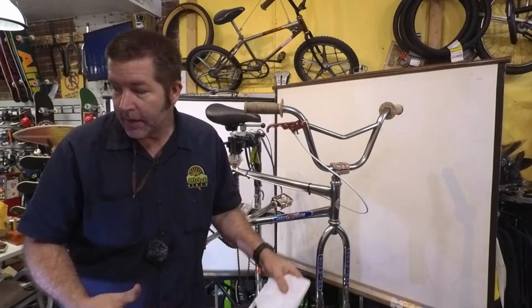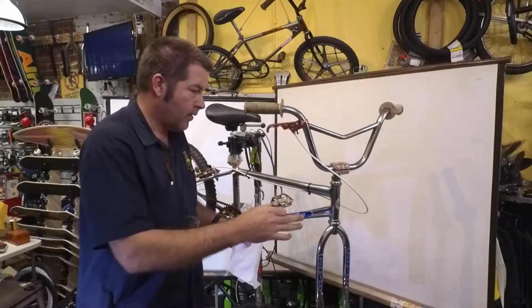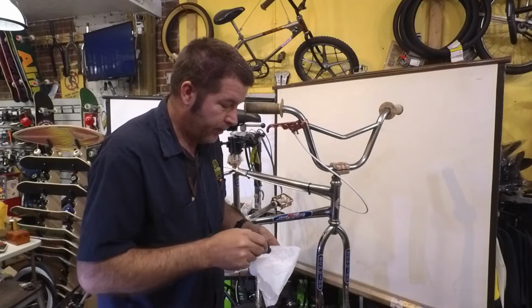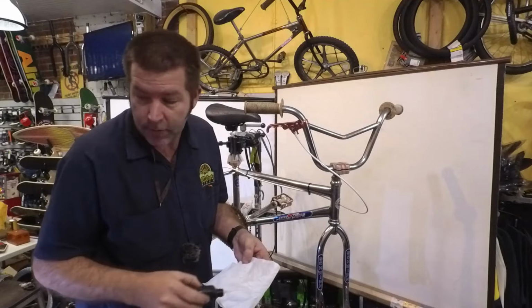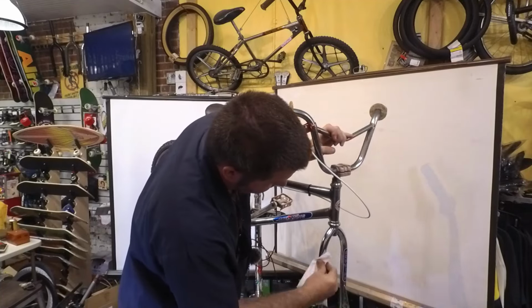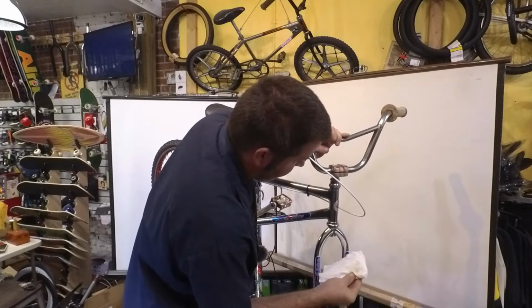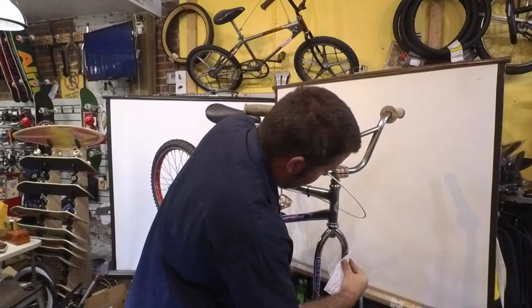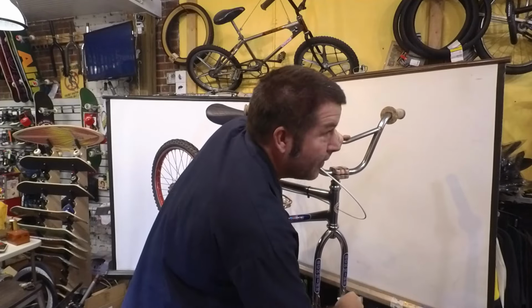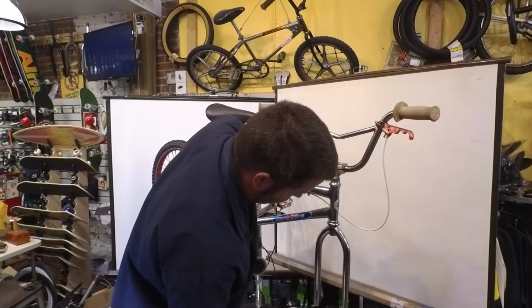Anytime you're cleaning the rust off the bike, you need to actually make sure that you use a good gun oil or some other Teflon wet lube to wipe down the metal to keep it from rusting. You can also put a clear coat on there, but that's painting and I try to avoid that. Okay, let's go ahead and put some of this oil in the crevices that are hard to get to,